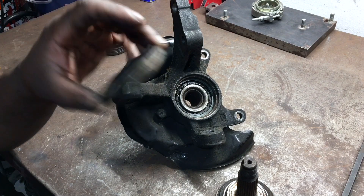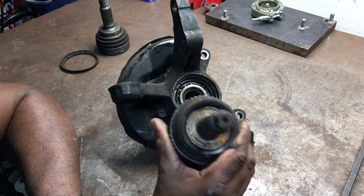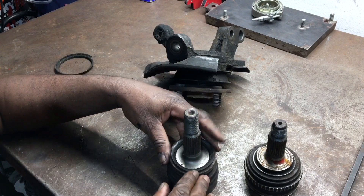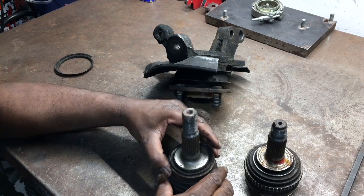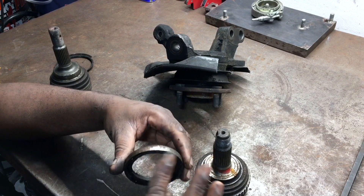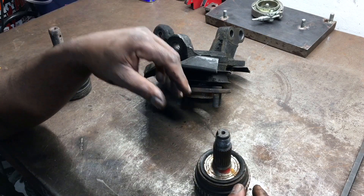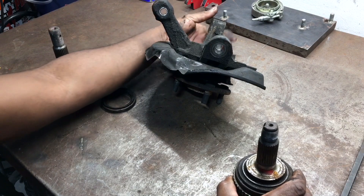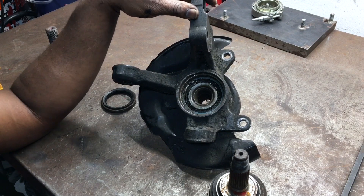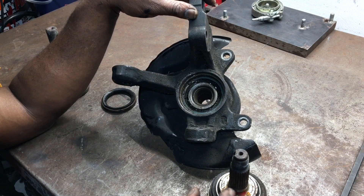I also found out I might even be able to use the stock Toyota dust shield - see how it fits on the Honda hub perfectly. On the Toyota hub it actually fits in and clears the outside. So I'm going to retain the dust shield but just shave the back of the hub so once we put it back on it'll sit further down and we can use the dust shield. I'm not going to modify the axle - that way if I ever have to change the axle this part is already modified, just in and out.